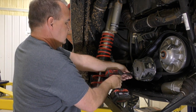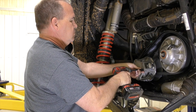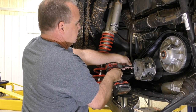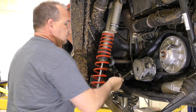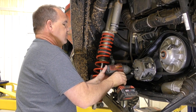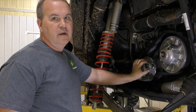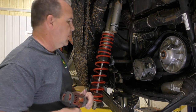I'm going to double-check mine. Put my bolt back in and tighten it up. This is supposed to be torqued to 96 foot-pounds. Same answer as before — people get in trouble trying to torque it. Very few people do it this way; it's my method. You do what feels right.